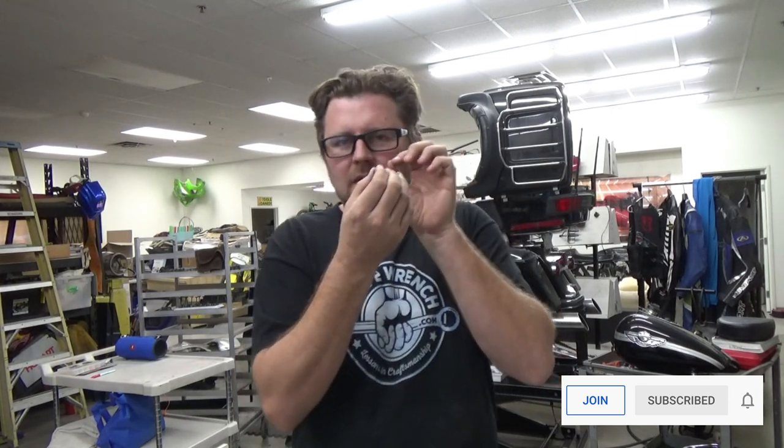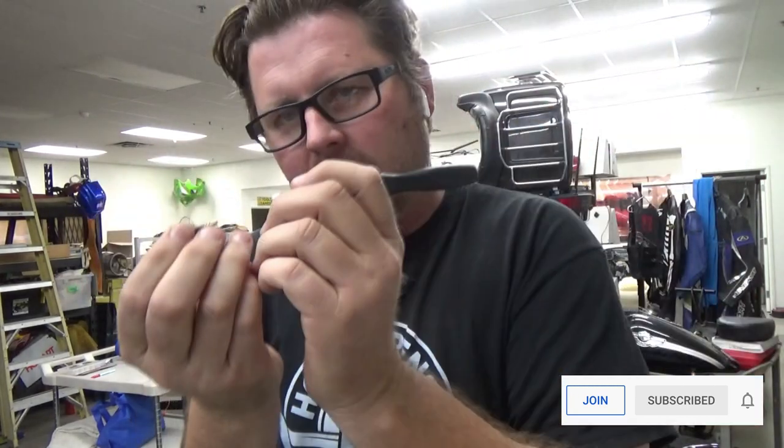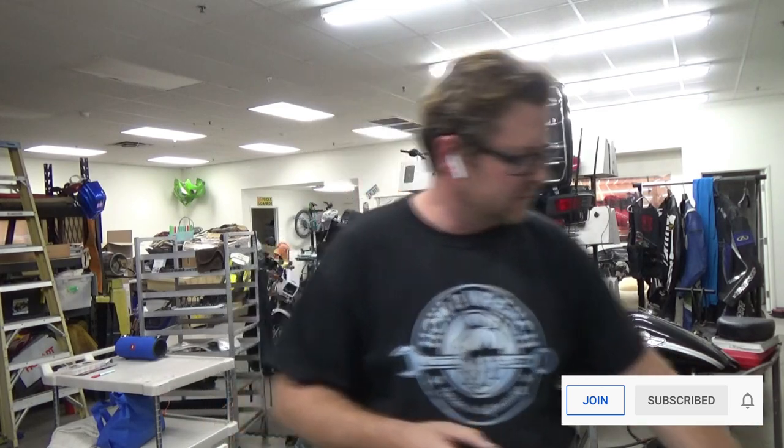But when you're just getting that feel, if you noticed my technique as I was getting in there, I wasn't just ramming it in. I'm just kind of poking the varnish, because that's what's happening. When you leave these sit, they get that varnish on there. And the fuel is so bad nowadays, you might have 30 days and fuel's bad and turning to crap and plugging these up. So if I could get the smallest little hole through, then I can go back to chemical cleaning if that stuff were small enough.